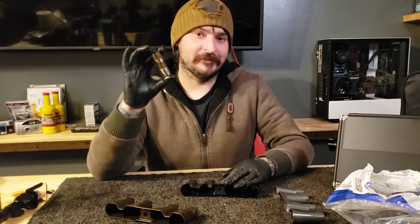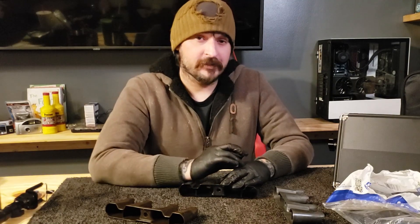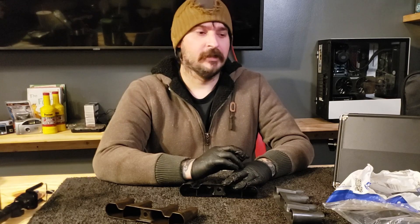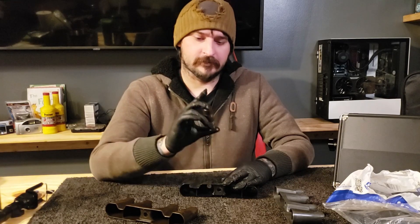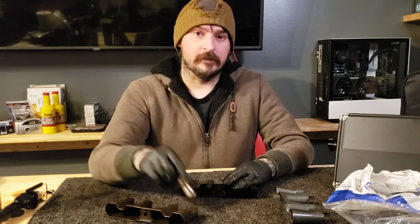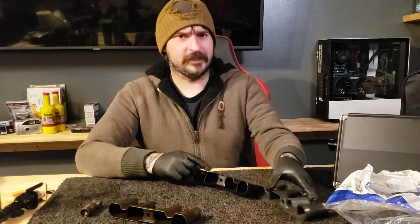This video isn't specifically about lifters, but I highly suggest you also buy your lifters from the Chevrolet dealership. They're about $15 to $16 a piece, which is expensive — especially if you need 16 of them for an LS engine. I highly recommend LS7 lifters from your local GM dealership. If you're on a budget, keep that in mind; if money's no concern, go OEM.